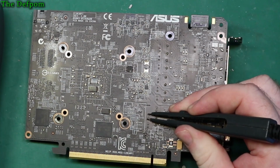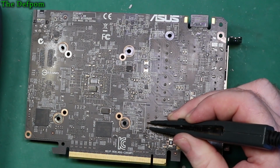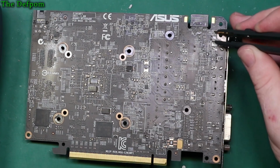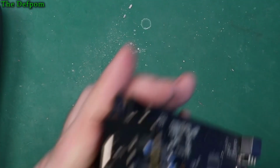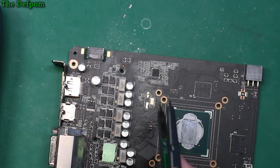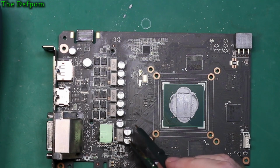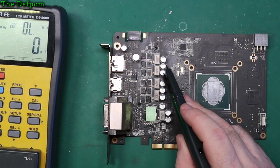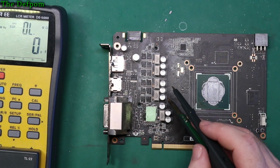So here we have 0 ohms, 2.2 millifarad, and the same again. 292 µF, 0.1 ohms, that looks right. 783. That's a 560, so it's actually a bit high, so that cap might be bad. But which one of these is bad? That's a good question. So that's 820, 1640, 3240, for about 5,500. So yeah, 5.7 millifarad for all of them together is about right.